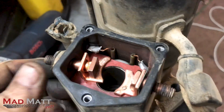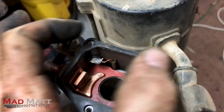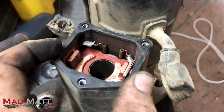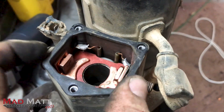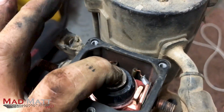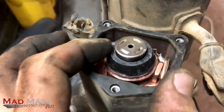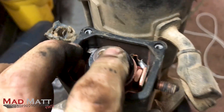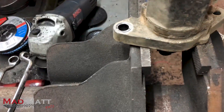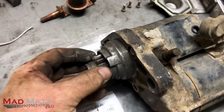The electricity to start the engine isn't like 10 or 20 amps across the magnetic field — you actually need two, three, or four hundred amps to start your engine, which is a lot. That's why we have big wires and big terminals. So that clicking noise is the slug getting sucked down by the electromagnet, but when the connections under those terminals are dirty or worn, we don't get electricity traveling from one side to the other, therefore the motor can't run and the engine can't start.